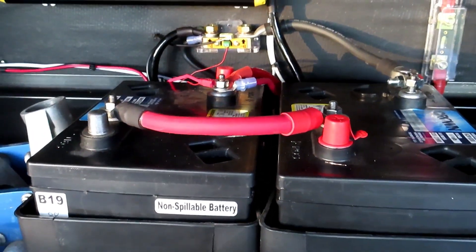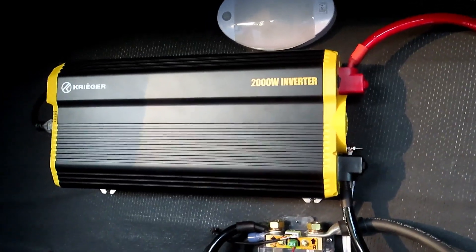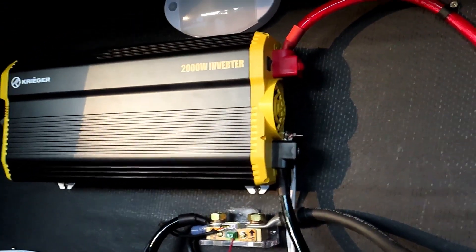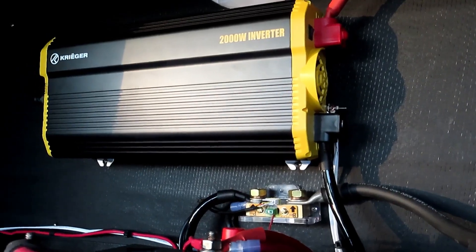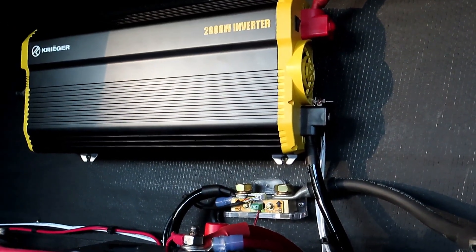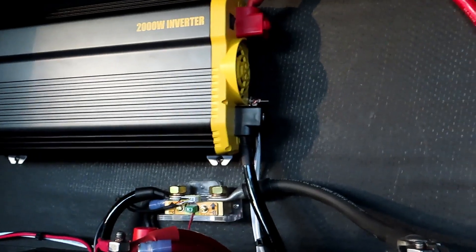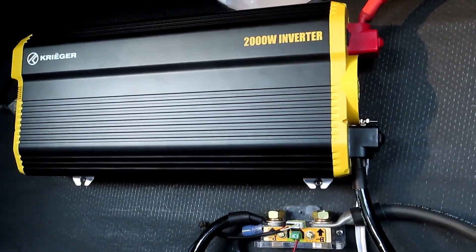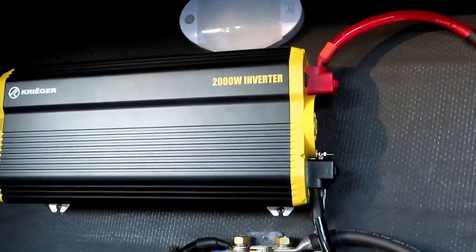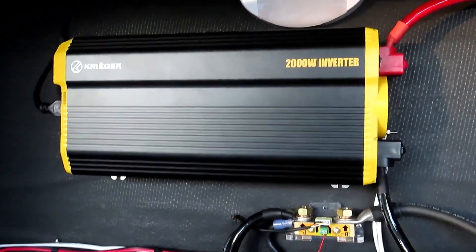Then I started doing a little research about inverters. There are pure sine wave inverters and modified sine wave inverters. For our needs I decided to go with a relatively inexpensive modified sine wave — we're not trying to run a lot of electronics for extended periods of time, really just a day or two or an overnight stop. This one we picked up on Amazon — it had really good reviews, it's 2000 watts, came with the cables and the fuse block — everything you really need to install the inverter. We'll have a link in the description.